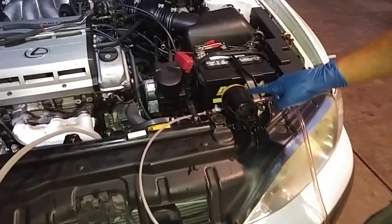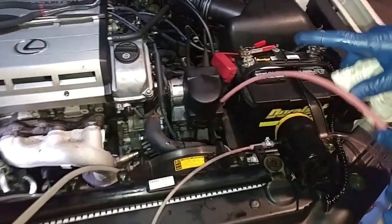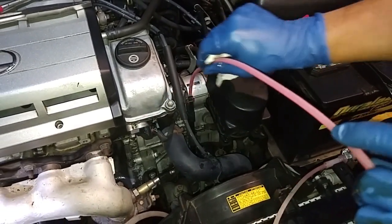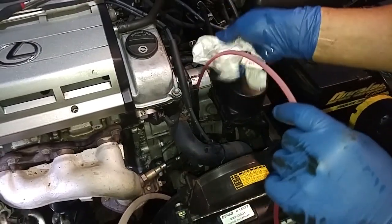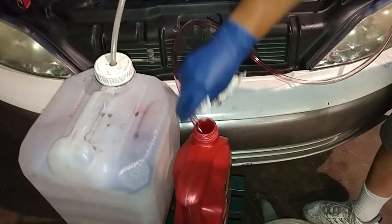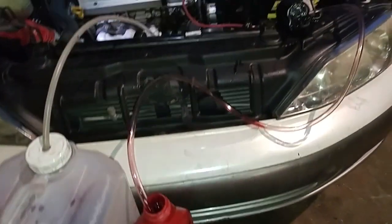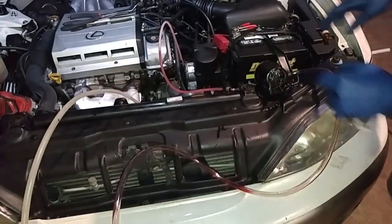This is an oil pump and we're going to put it into the dipstick porthole. Now if you don't have a dipstick porthole, you could locate the transmission side service port for those that don't have dipsticks anymore. We'll take this supply hose and put it into the container of new transmission fluid and pump in four quarts of transmission fluid back into the transmission oil pan.